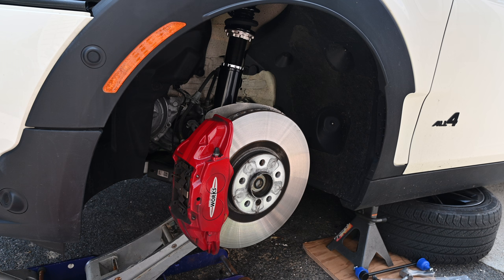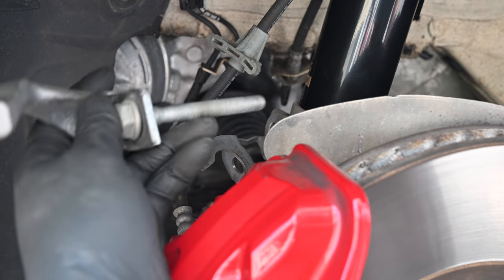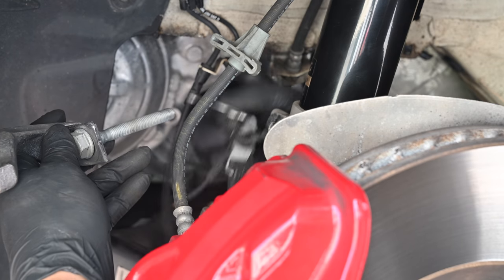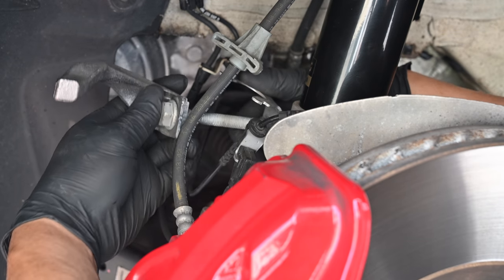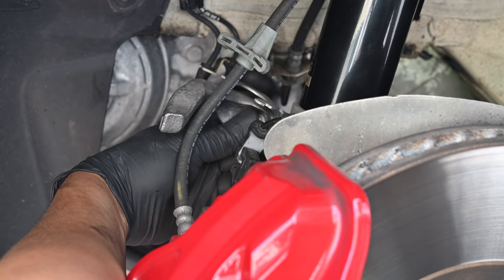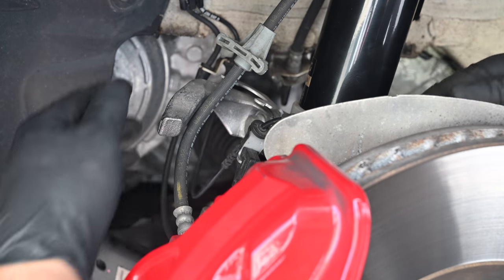There you have it - now you can start assembling the bolts. We got the bolt and this little arm bracket - I'm sure there's a technical name for it, but it's an arm bracket dealy thingy. This goes before that - you want to feed the bolt through because it has a little arm that reaches around and grabs the bolt. Put the 16mm nut on the other side and then just hit this with an 18 ratchet, hold the back side with a 16 wrench, and that will do it for mounting the shock. Then you remount the brake cable or brake line guide like so.